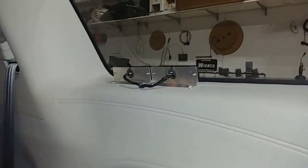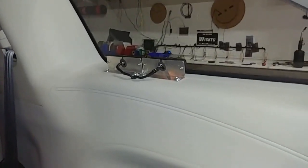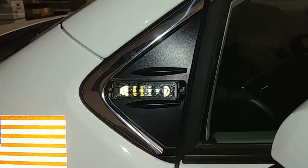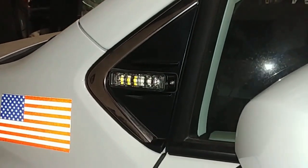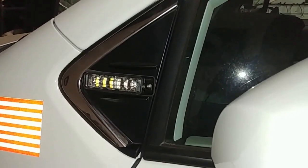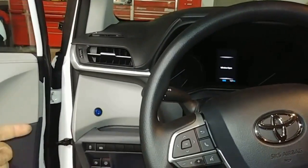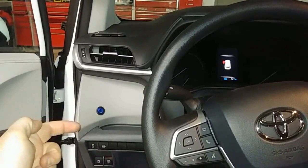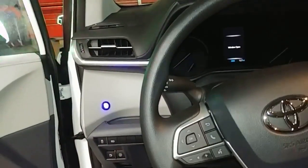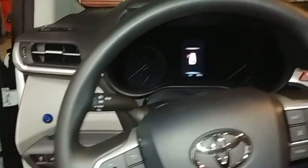Here inside the van, you can see we utilized our LIN-6 brackets and just ran the wire straight down, putting those lights right up against the glass. Here's a shot of that green-white LIN-6 right on that front mirror panel — fairly easy, panel pops off, wire goes forward into the inner fender, comes out underneath the hood. Here is where we put our switch — running most of our wiring connected and terminated behind the side panel over here. We put a little label on that switch and just did a full illumination blue switch. Lights up real nice here in the cabin of the vehicle, kind of hard to miss.